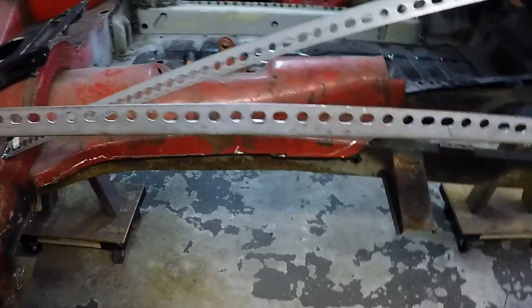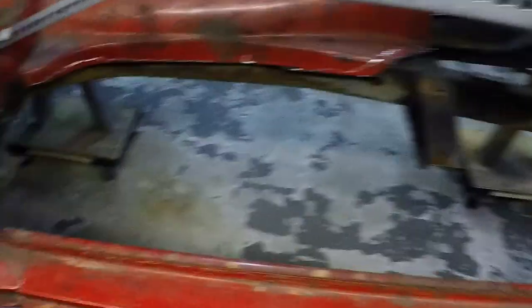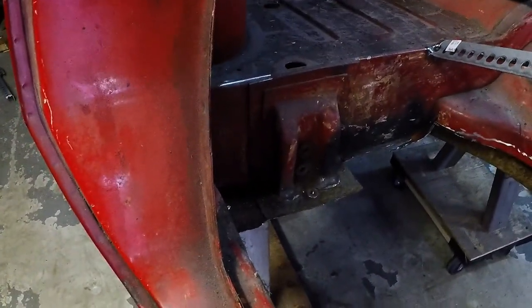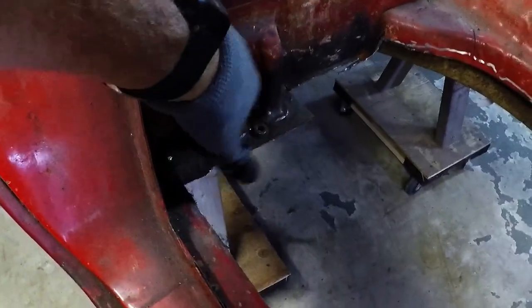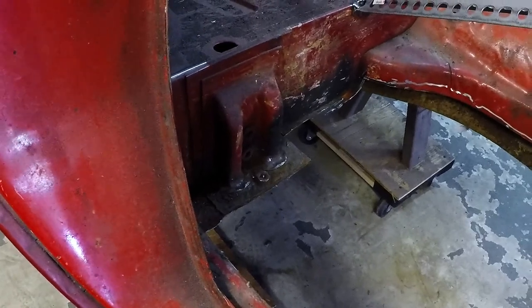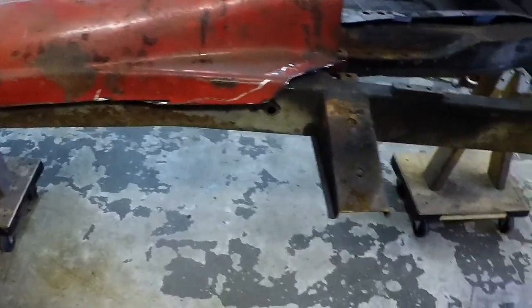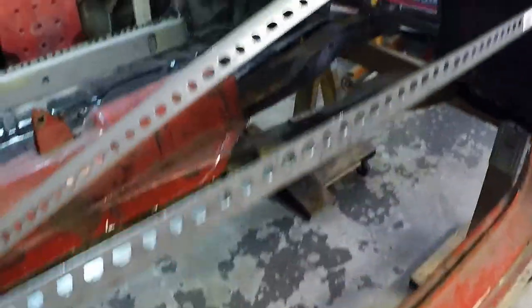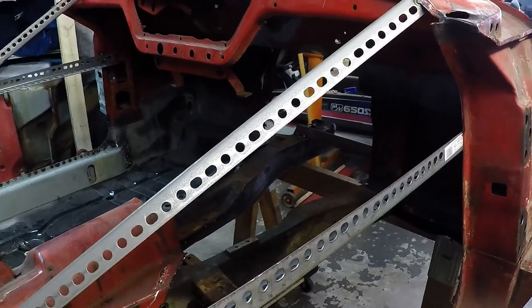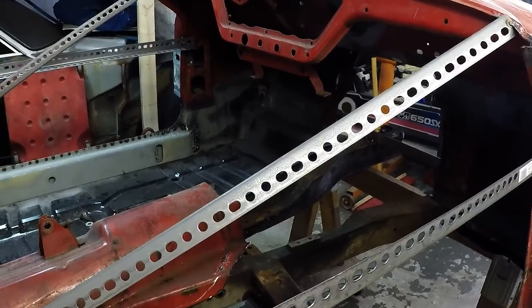It's 1:45, we're done for the day — got to go get some ice cream. We got the passenger side floor out; obviously there's a lot of cleaning up to do. That rear heel board reinforcement for the rear trailing arm — I'm not sure if this one is going to need to get replaced; need to get it cleaned up and take a better look at it. You can see the frame under there, so that made it a little better. All the front still needs to get cleaned up, but the floor is out and hopefully the body's a little bit better supported now. We'll see what happens with the next visit during the week.